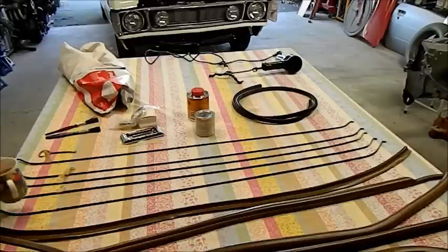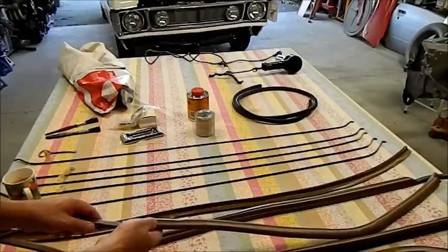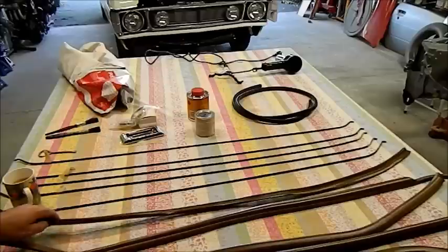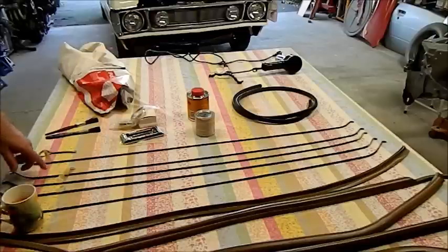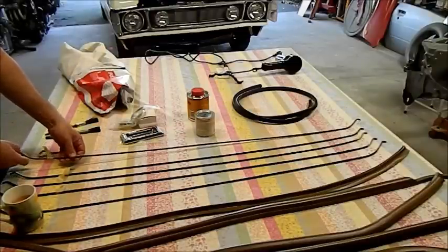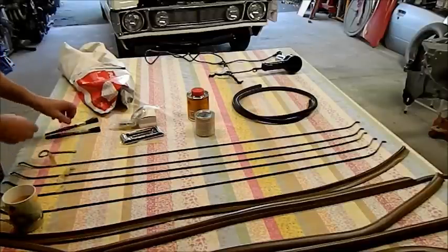Got to discuss a few things. I have a friend, Jason, coming over. He's going to help me put the headlining in today, and I've got a couple of bits ready. Padded wing lace, which I've painted using a Flexo, so it's nice and flexible. They're all done. I've got the four of them there, plus the front moulding that pinches the headlining into that steel trim. All the headlining bows, numbered 1 to 5, I took off, was it the 8th of June last year? I looked at my notes, and so that's 18 months it's been without a headlining now.